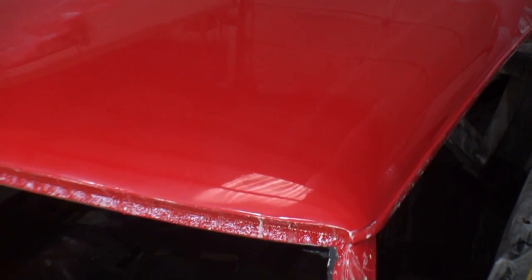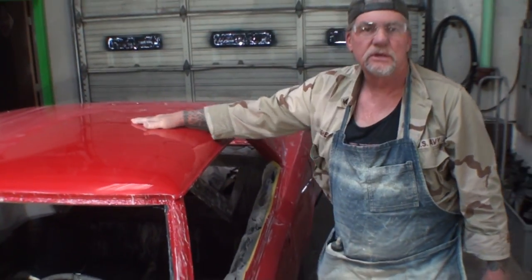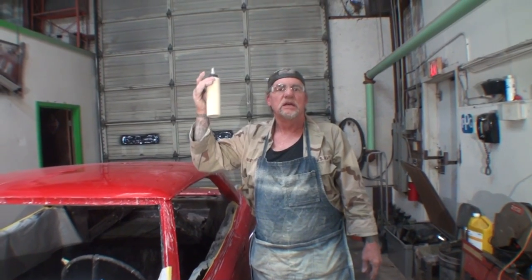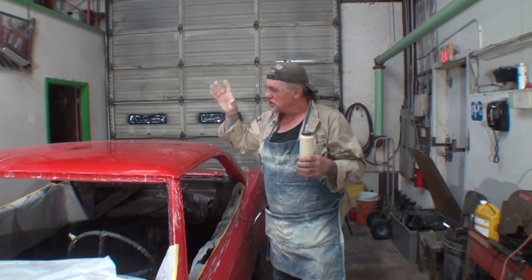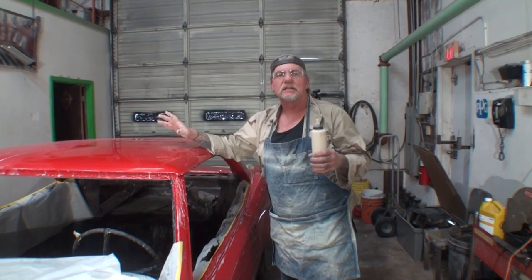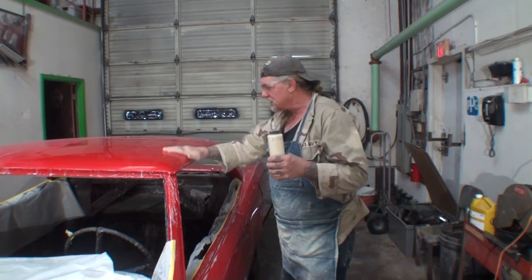So that is what the 3000 is going to do for you to make the job come out a lot quicker, a lot faster, and you're going to use one third the material. Am I right? Yes. You can buff it at 1500, but if you go to the extreme of using that finish polishing pad that I showed you, this is the finish you're going to get.